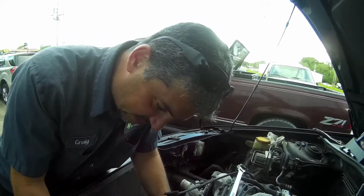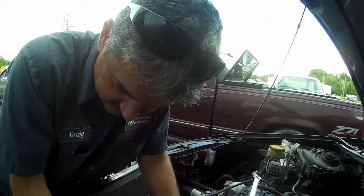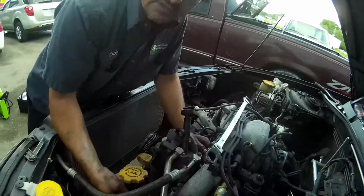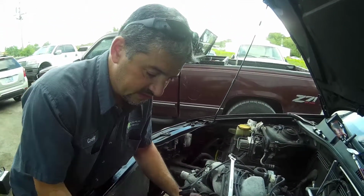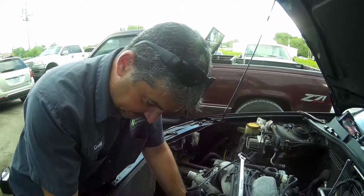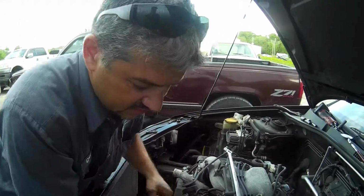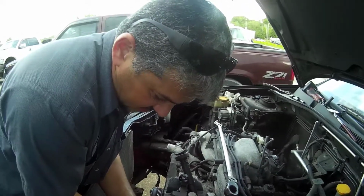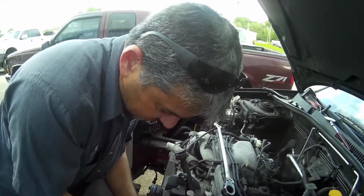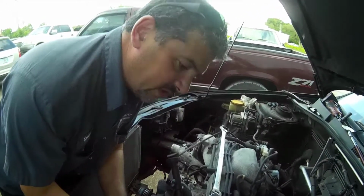I'm hoping that everything goes real smooth, that it's literally just like the manufacturer says, that the motor mounts allow it to slide right onto the frame rails with a 5.3 AC compressor. And if that all works out good, then we're golden. We'll put the harness on it, and of course we've got to get the adapters for oil pressure and cooling.